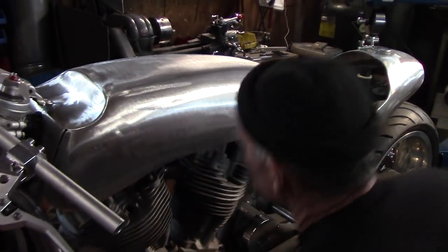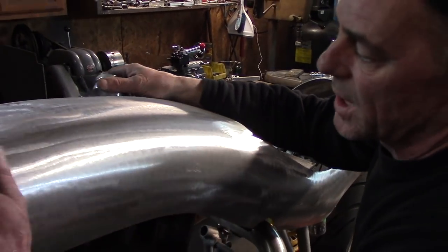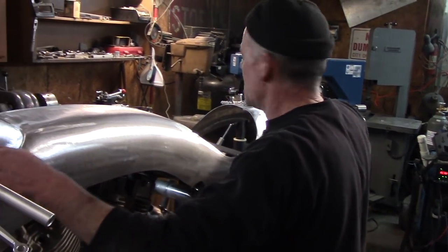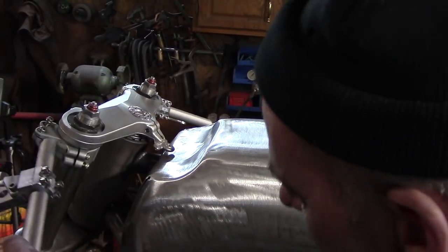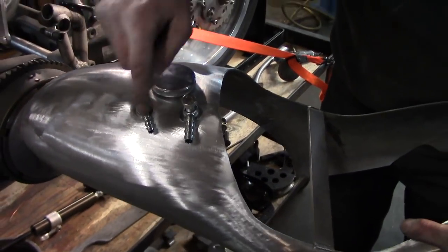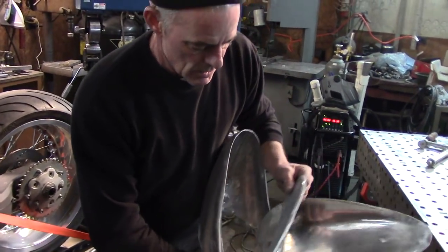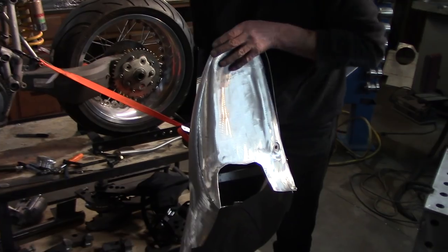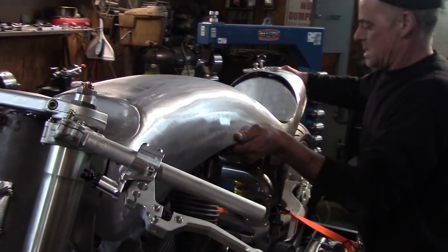This gas tank — made a matching filler which is going to go about here, matches the one I've made up for the back there. Pretty much got this side finished. This is really close. Get the mounts done. I've got all my clearance for the supercharger and everything. I'm going to hand hammer a little relief into here so it clears the triple tree for the steering dampener. I've made these bungs up. This oil filler is the seat in the back. This is my crankcase breather line and my return oil line — these are going to have hard lines run on the outside. This is the bung I made up for the feed line. That'll be welded obviously so the oil doesn't run out. This fits nicely around the suspension at the back.